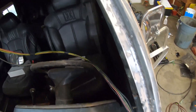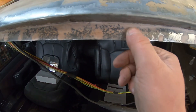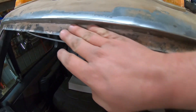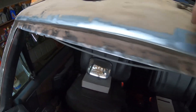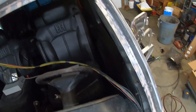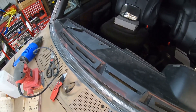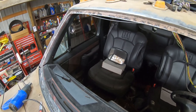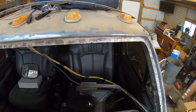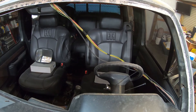It's coming along. I've got most of the little pits and low spots filled in and smoothed out. I might go along and rough the whole area up again with some 100 grit, then blow all the dust off, wipe it all down, and hit it with 2k epoxy primer — probably give it a couple light coats and let it set up for several days. Got a few days until the glass shop comes.